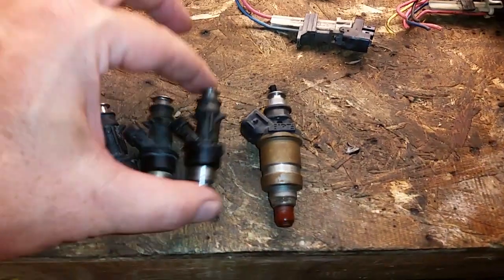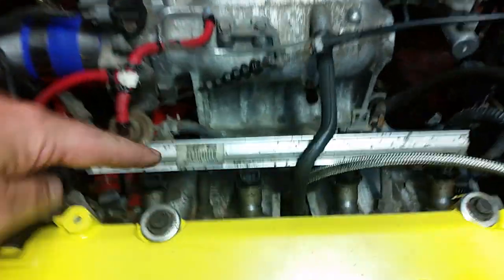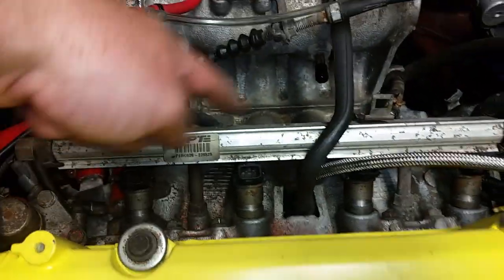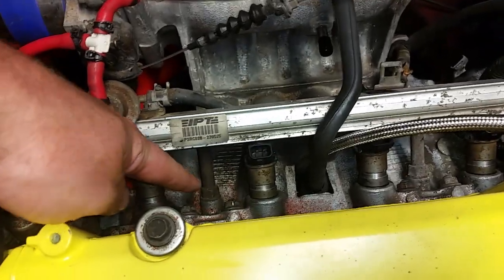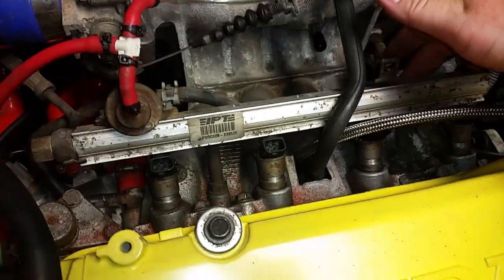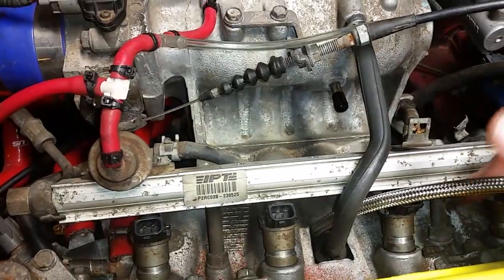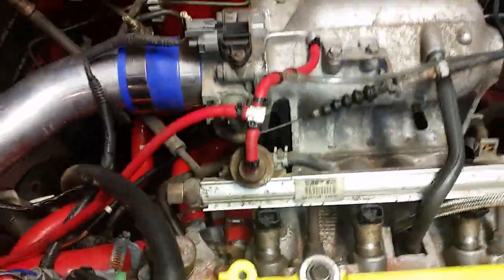There's a factory 240cc D16Y8 injector and here's the GM one. I was asking Hunter — I said hey man, this thing doesn't look like it's going to fit in there too well. On the Y series they got this stud here with a 14mm bolt down there and a 10mm at the top. He was saying even on Christian's PVC Civic that they worked on, you just drill this hole back here where the 10mm goes into, open that up a little, do a full bolt in there, and then use that nut to bring it all the way down — nut on top and bottom to hold the rail, and obviously screw into the intake manifold down here as well.